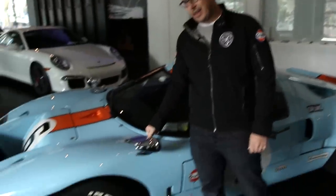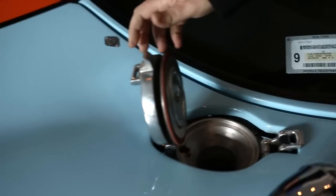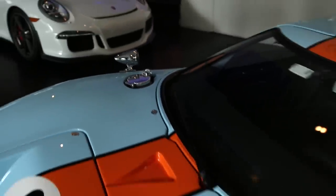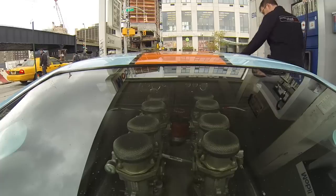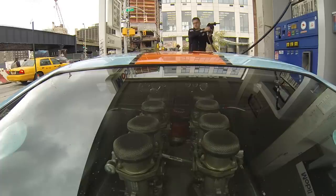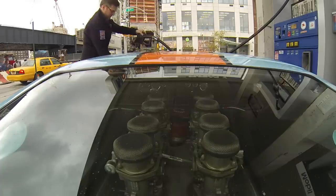Before we get in the car, really quickly — basic stuff. Fuel caps are on the outside. Just flip that up and go straight down the tank. There's one on each side and they are separate tanks — they need to be filled separately. This filler does a 90-degree turn directly below here, so you don't want to pour fuel in too quickly or it'll gurgle up. You've got to take it easy and go slowly. So even if you're in New Jersey and the guys are trying to pump it for you, get out and help them so they don't flood the things with gas.